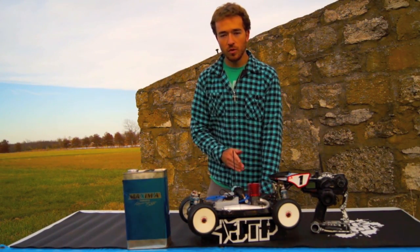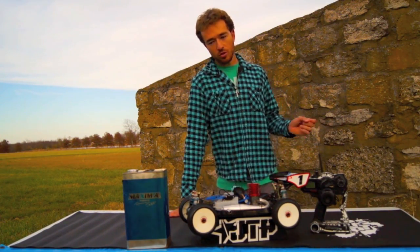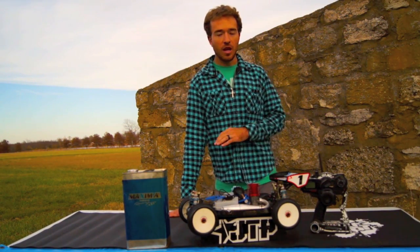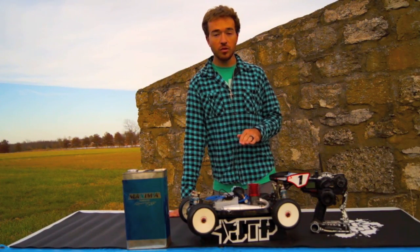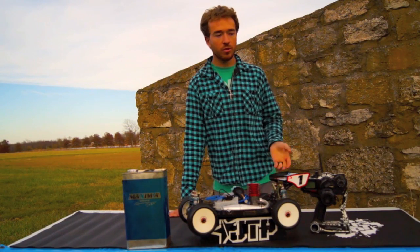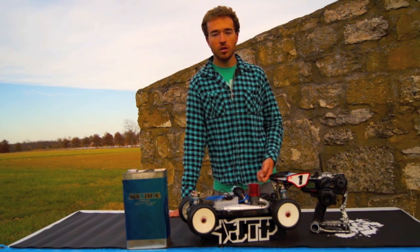So that's one thing to look for. Then after I get that sound where I want it, I'm going to just go through all the RPMs — start at neutral, roll through all the way to full throttle until the higher RPMs come up — and then again, listen to the idle. You want the idle after the high RPMs to set not too high, pretty good, and to stay really consistent. You should be able to count four or five seconds without the idle dropping. If it's still dropping, your bottom end is still a little bit too rich.